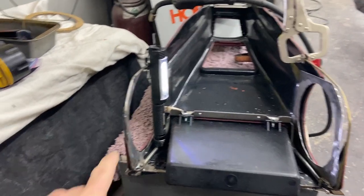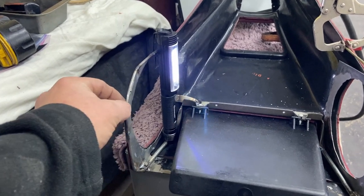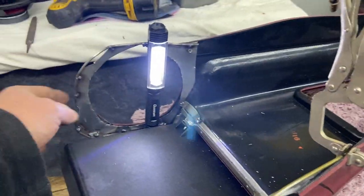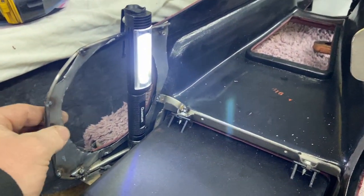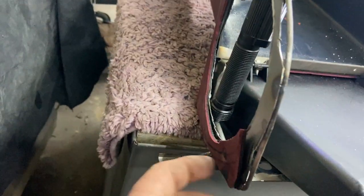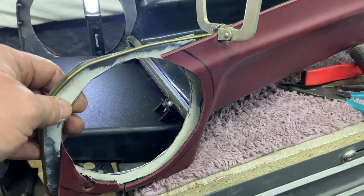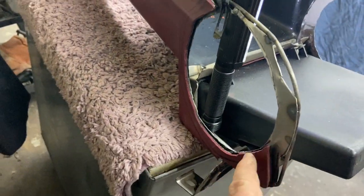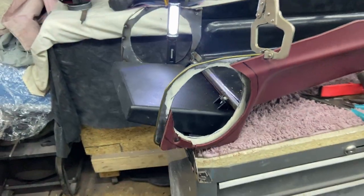We're getting into the real deal now. I got my side figured out. I wanted to fortify things a little after I drilled my holes, so I took some steel and some rod and got my template going to hold the speaker — it'll slide right in. It'll have a good surface to bolt to, not just the plastic. I used a rivet to get this metal held, and when I do the screws for the speakers that'll suck all of it in together — should be pretty cool.